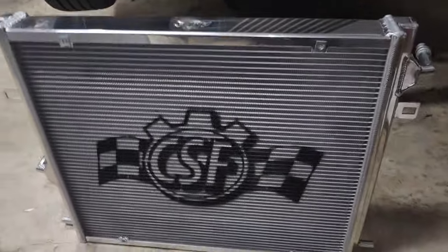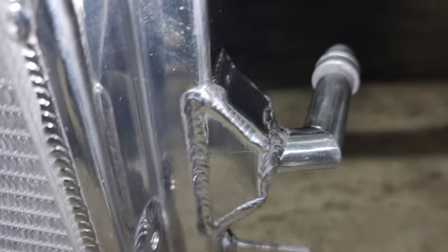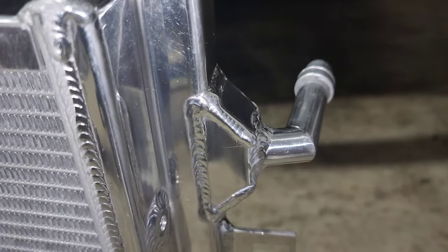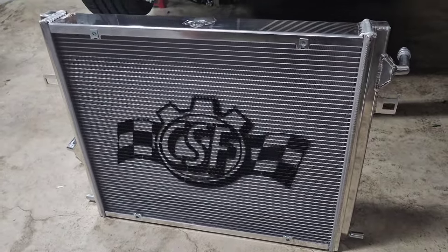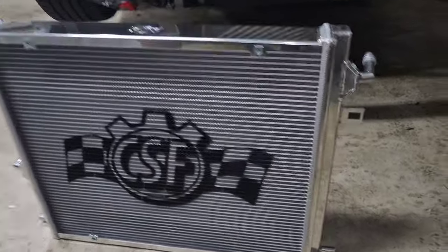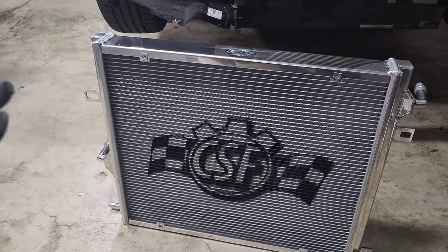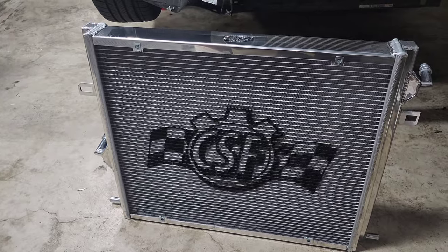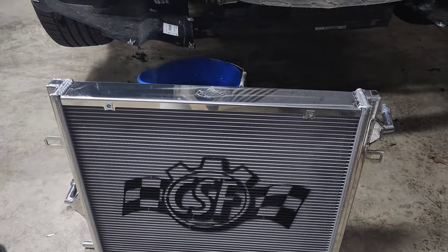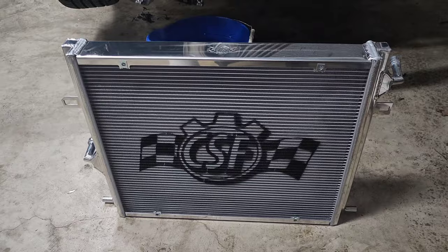The bracket screws into the side and one of the transmission cooler lines mounts on there to hold it in place — another thing you don't always see considered in aftermarket solutions. Another feature is the end tank design, which is tapered rather than a straight fitting. This helps alleviate bleeding issues, which we've seen a lot of on the B58. These cars are a little sensitive since the intake manifold is the highest point of the system rather than the coolant reservoir, making bleeding more difficult. The tapered design matches the OEM end tanks exactly, so it really went through the extra R&D steps to address common B58 issues.